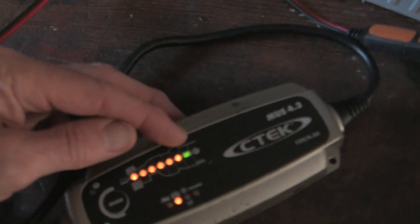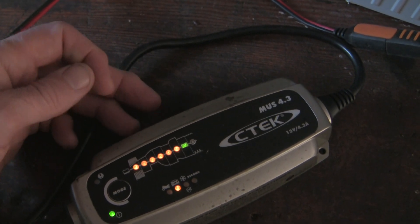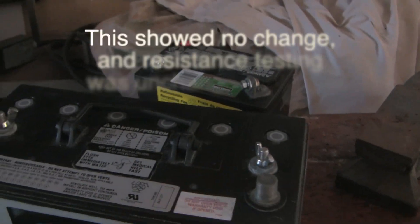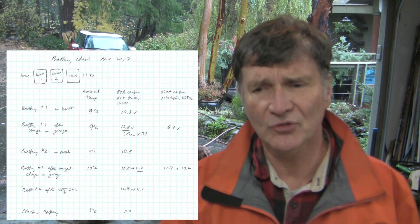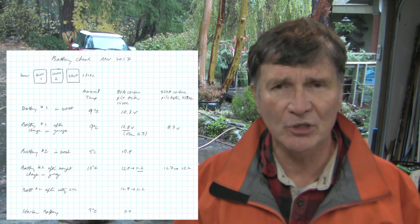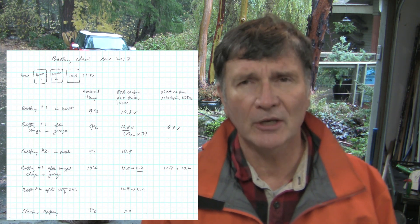After 24 hours the program has given us a green light saying the battery seems to be good. I'm going to take the leads off and give it another 24 hours to see if it holds a charge. We've tested each individual battery in isolation and proven that none is acting as a drain on the others. We've also got objective data using different measuring techniques to see what each battery can put out, which will be useful for future comparison. In particular, AGM batteries are hard to assess, and having an objective baseline to compare against is going to be very useful.